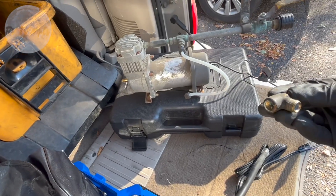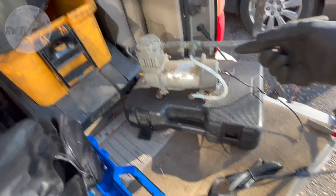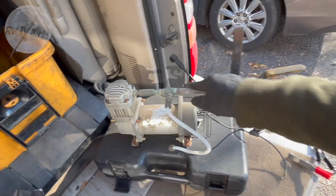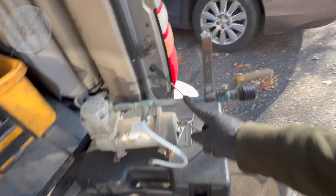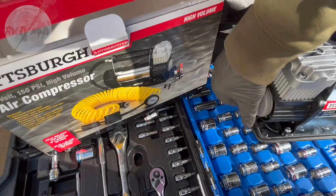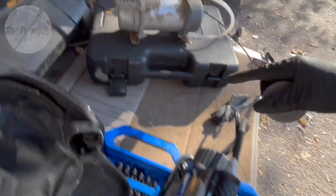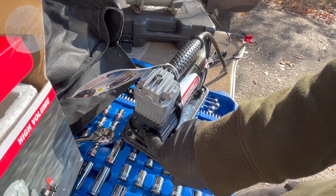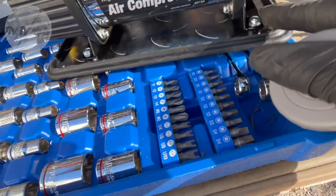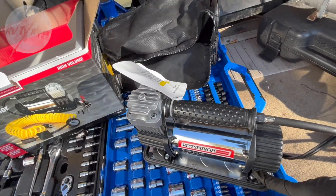I might do that because if I could do that I wouldn't really even have to modify this at all — I wouldn't have to take it off this plate and put it in here. Truth be told this shaft right here is mostly just this handle and it comes out here, so I do not need all this — it would stick way out of the RV. That end is threaded so I could just thread that thing, take it right out, put it in here, and keep the same system. It's essentially the same pump, just a little bit newer, and these same bolts are on here too, so I should in theory just be able to unbolt it and it should almost completely line up with the holes in the RV and bolt right into place.